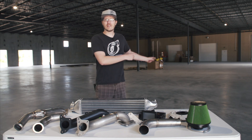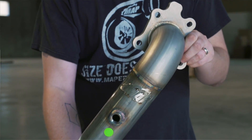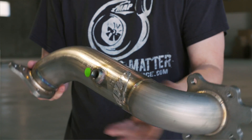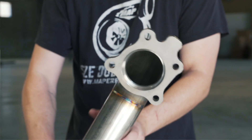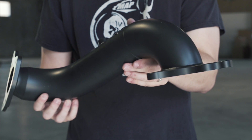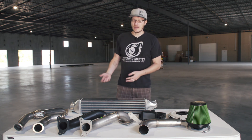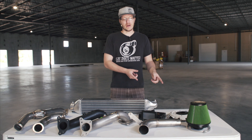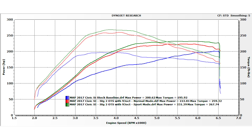So we've got the air going in — now we get the air going out. The most restrictive part on a turbocharged car is typically the downpipe. We've come up with this design here: our MAP 3-inch downpipe, again made from 304 stainless steel with CNC-cut flanges, all in-house with a lifetime warranty. Great flow and good performance upgrade — we also offer it in ceramic coating for those who want to protect against under-hood temps or for track use. Once you've got the MAP intake and the MAP downpipe, some additional tuning will have to come back into play, which is why you should have a K-Tuner or a Hondata right from the start. If you purchase the MAP intake and downpipe, we'll provide our off-the-shelf Stage 2 tune to accommodate, free with the purchase of the kit.